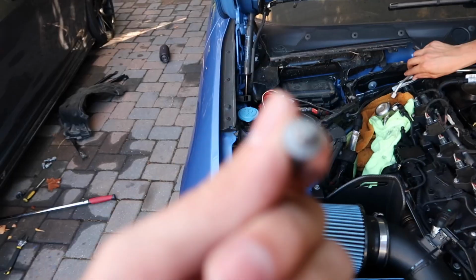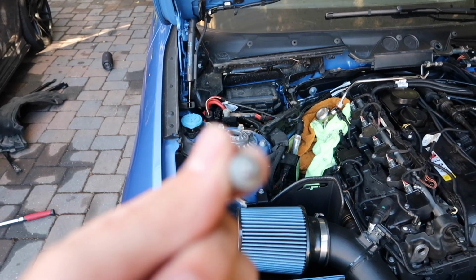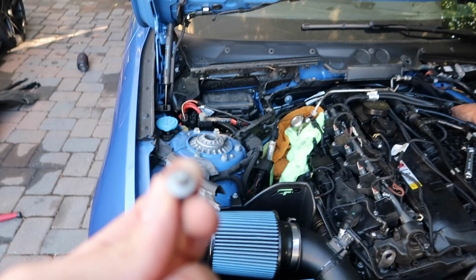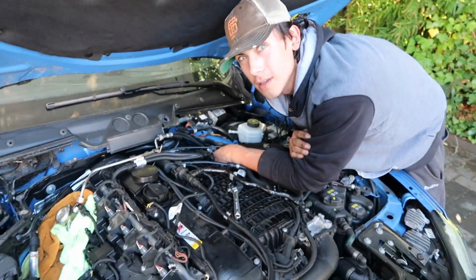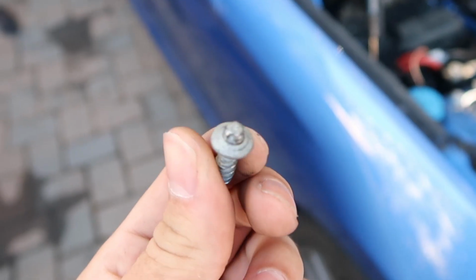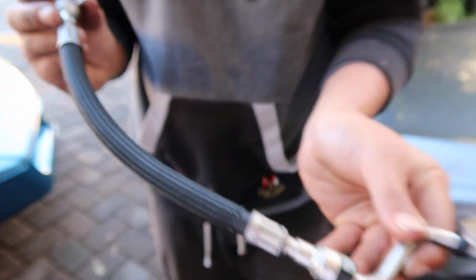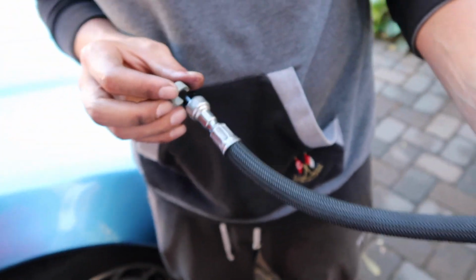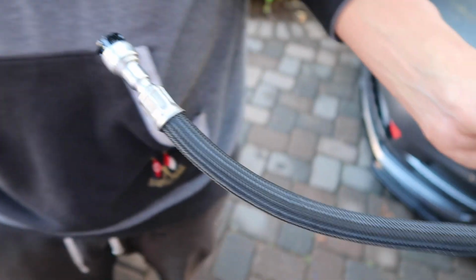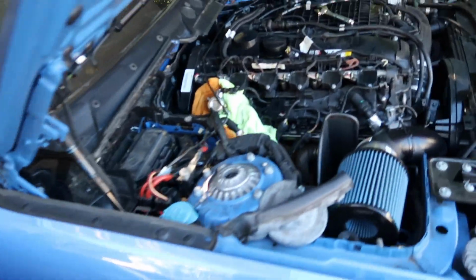Dude, what? This is a 5 mil E bit? Oh, is it? I took it off with a... Did you actually? Yeah. Dude, it's an E bit. I was curious. I was like, that doesn't really look right. Why would anyone build a car with this? Hold on, let me show you this. Look at that. That's horrible. Okay, that is out. You have to take off this little gray clip. Yeah. And then push this in that way and then pull it off, and it takes a good amount of force. What's next, Enzo? The fuel pump.